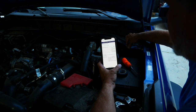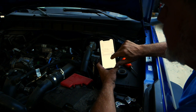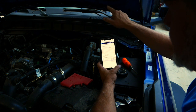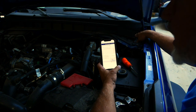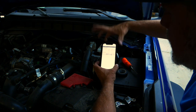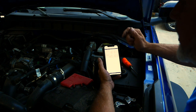You also have non-powered circuits — lines run to the front pillar and to the back — labeled B1, B2, C, D, and E, tied up by color. I'm going to run power directly so I'll use switch 5, which is blue and orange. I pull the blue and orange wire, cut it open, and link it directly to the wire coming from the power side of one of the light units for instant power. I shrink that connection and take a picture of the wiring diagram so I don't have to go back through the owner's manual again.